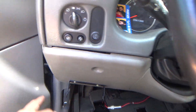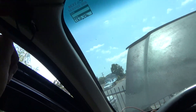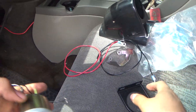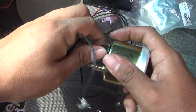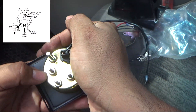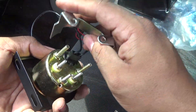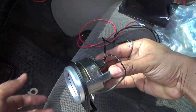Grab the wire, put it through here and set it in. Pretty much I could tuck it in from the B-pillar. It's going quickly — connect the wires. Put this part in there first, then disconnect everything again and go put it in there. Put the little light bulb in there, then connect everything else. You have your signal wire here marked with S, negative for ground, and positive for positive. This part comes in here and holds everything together — when you tighten this one it puts pressure on the plate, and you can mount it wherever you want.